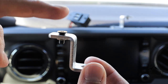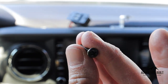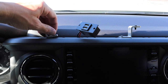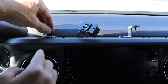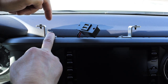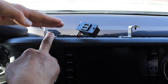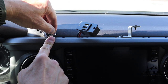Keeping the screws in all brackets so I don't lose them. Take a one-inch, 8-32 Phillips head bolt with a black washer and insert it into the bracket. Now screwing this into the bracket behind the stereo. The way this bracket is angled, you'd think the screws go straight down, but they actually go in at an angle because inside the panel the bracket isn't flush. Move the top of the screw head toward the front of the vehicle to make sure the threads align.